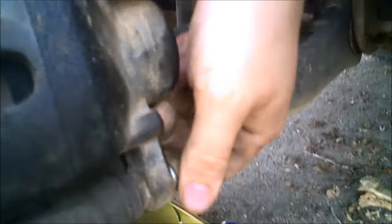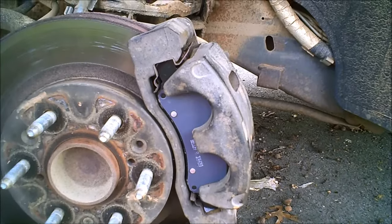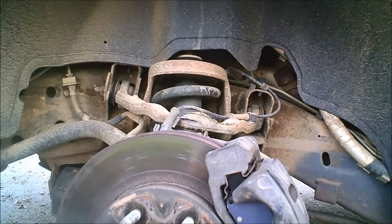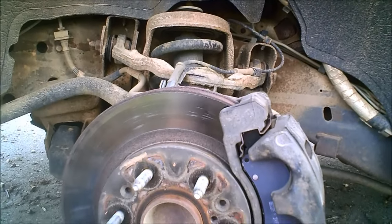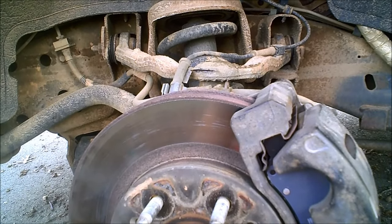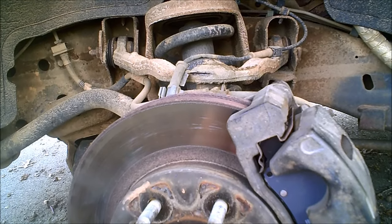The tire will keep the caliper around, but braking won't be as effective if bolts are loose. Basically done — just put the tire back on and do the other side exactly the same. Tighten the lug nuts snug before dropping the jack, then fully tighten them up and put the hub cap back on. Hope this video helps — it's pretty simple on a Chevy. Fords are a little more difficult because you have to pinch some pins together.